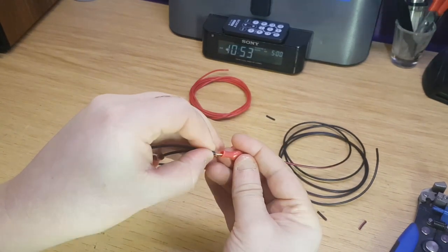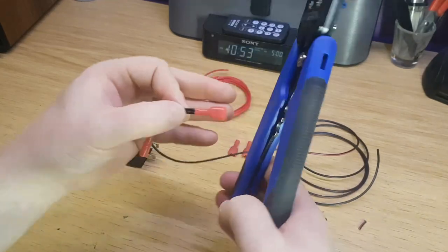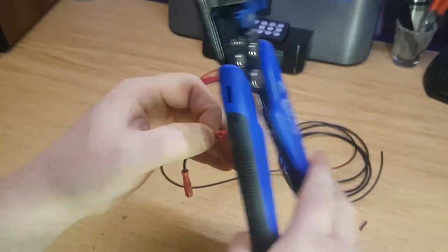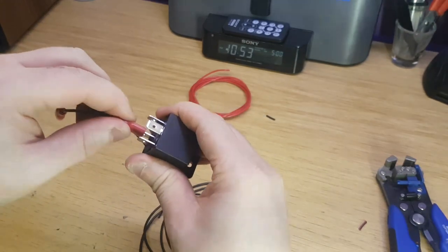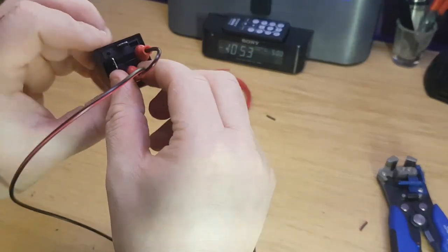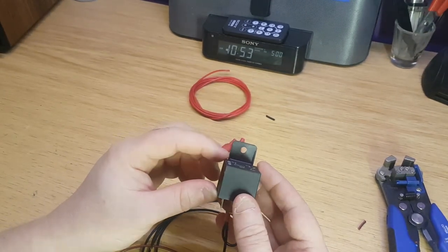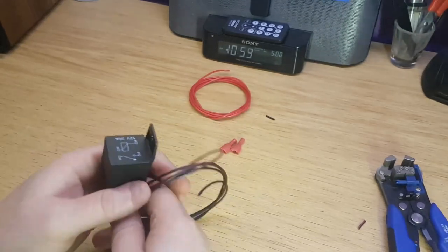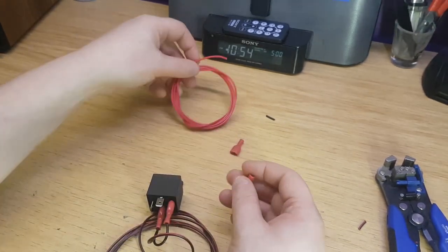Get a bit more of your black wire for your ground, do the same — twist those two together. Get your crimp, push them both in — that's creating your bridge. Crimp it down, and that gives you your bridge and also your ground wire. So you've got pin 30 and pin 85 bridged together, and that ground wire can go behind the kick panel — there's a 10mm bolt there, just undo that and tap the ground wire in.